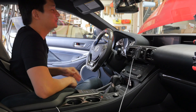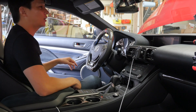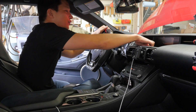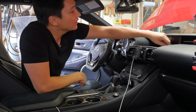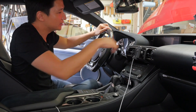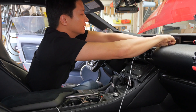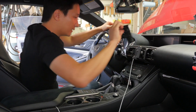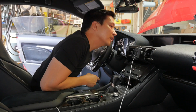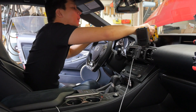While Shin is out there fitting the front camera, let me show you what needs to be done inside of the car. First, locate your screen and right under the screen you'll notice there's a plastic panel. We're going to have to remove this, and then under this plastic panel you'll find the screws you need to unscrew in order to remove the screen. Put this aside in a safe place and you'll find two 10-millimeter bolts.